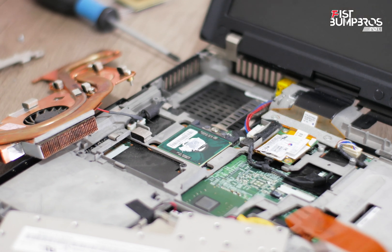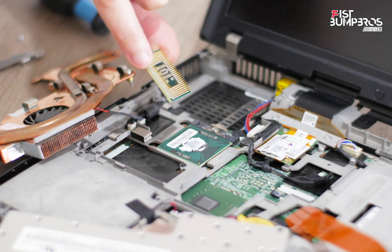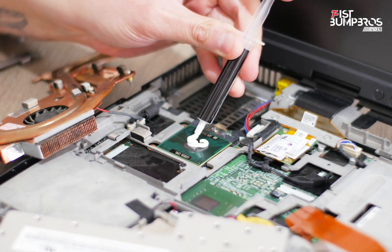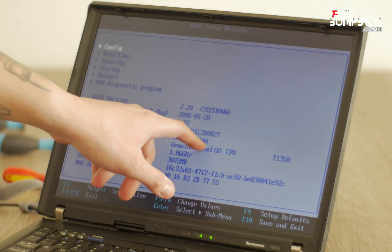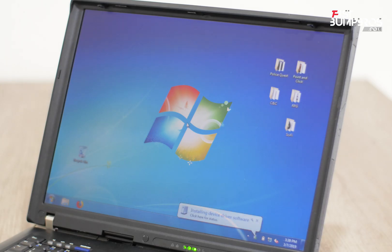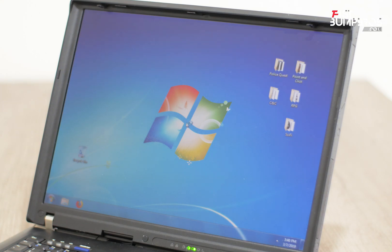This is the old CPU with its old cooling paste, and there you have the new T1350 single core CPU which I will finally install into the R60e. This is the same replacing job as the first one, so I'm just going to speed it up again. And there you have it — no black screen at all. It recognizes the genuine Intel CPU T1350 with 1.86 gigahertz, instead of the 1.43 gigahertz.